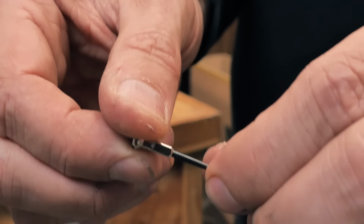After that, we have the 3 dimensions of wheel building, if you like. We have the dishing, so making sure the center line of the wheel is in line with the center line of the hub, unless you have a Cannondale, and we use a dishing tool for this. On this wheel here, I can use this dishing tool and I can tell you it's already a couple of millimeters dished off towards the disc side, which isn't cool, but it's a very, very quick job to sort that out.